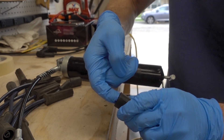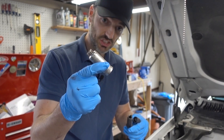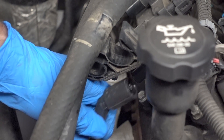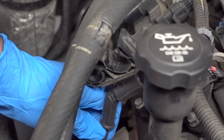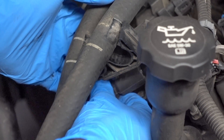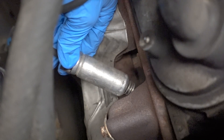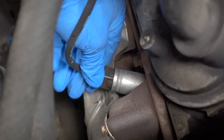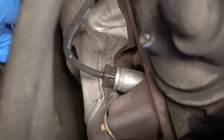I'll also apply a little bit to the inside rim on the coil side. And don't forget, if your vehicle does come with heat shields for the spark plug end of the wire, make sure you reinstall that. The first part of the wire I usually install is up at the coil, because this is an actual directional end — because it's angled, we want that angle to go down. Wiggle it a little bit — there we go — and then we should hear a satisfying click. Down at the plug side, we'll take the wire and simply fish it onto the plug, wiggle it a little bit to make sure you're getting it into the right spot. Just clicked in. That is one fully installed plug wire.